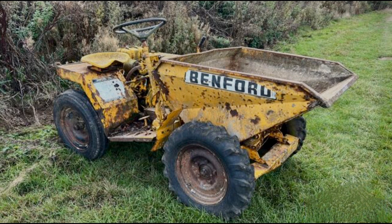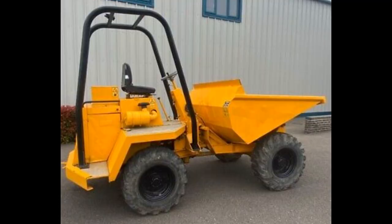When you arrived at the trench, you had to edge up to it and then operate the tipping lever. The vicious clutch didn't help, and there was a danger of ending up in the trench with the dumper on top of you. It was particularly difficult in the wet, or when there was a slight downward slope. Modern dumpers have a safety bar which gives a degree of protection. In the mornings, getting it going with the starting handle was quite difficult. That is, until they gave me an ether spray, a technique I noted for future use.